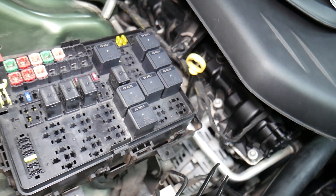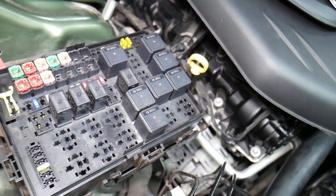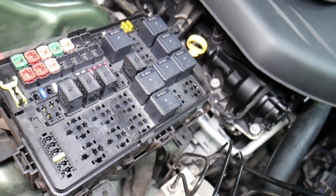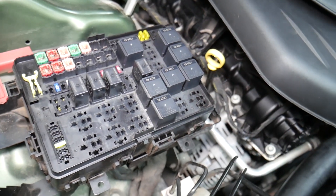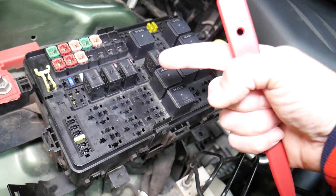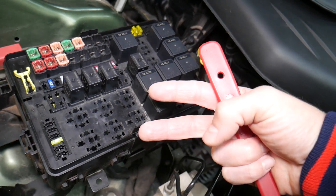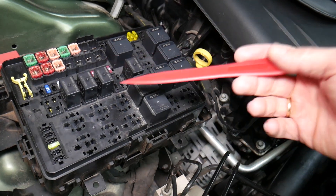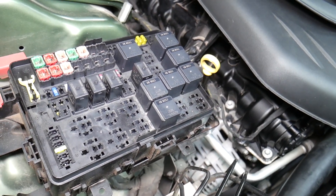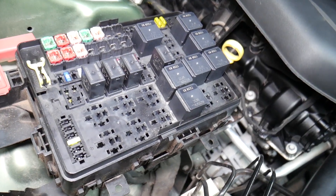For certain fuses, it's important to disconnect the car battery before removing them, otherwise you can burn the electronics. If working on airbag fuses, wait at least one hour after disconnecting the battery, and if you're not qualified and certified to work on airbag systems, never attempt that. Also, a common mistake is not knowing which battery terminal to disconnect and reconnect first — doing it the wrong way can burn electronic modules. We've burned a traction control module on a BMW before, which cost $2,000. We'll put a link in the description on which terminal to disconnect first.